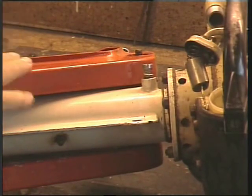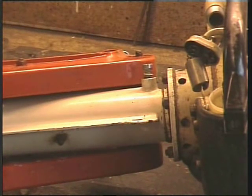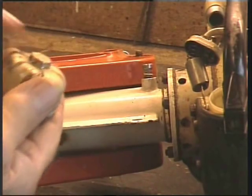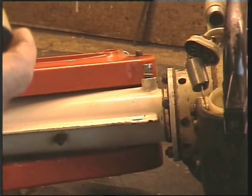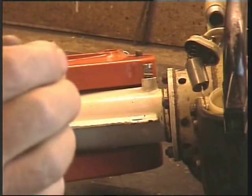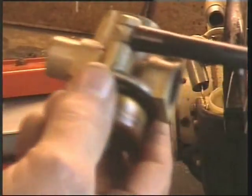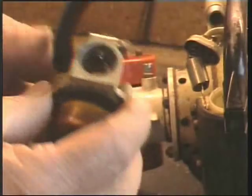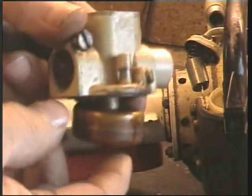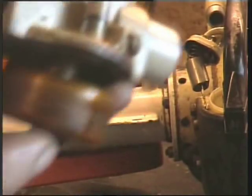Okay, well, if you're encountering one of these for the first time, and I've had similar outboards in the past, but not this particular one, I had troubles getting that bolt out. Well, it's not a bolt, it's an integral part of the bowl which threw me. And while we're on that part, I've yet to soak this, but by blowing down the end, this little float operates the fill valve.